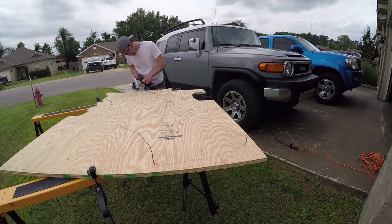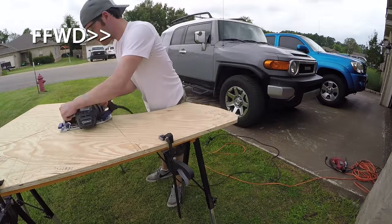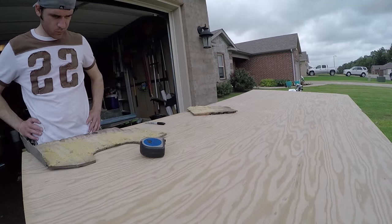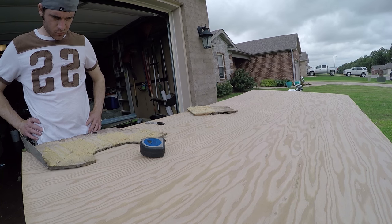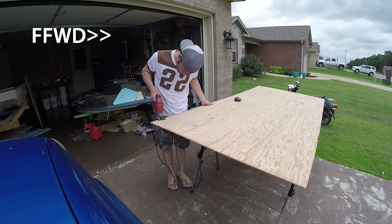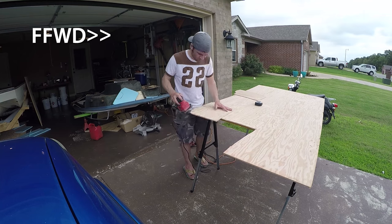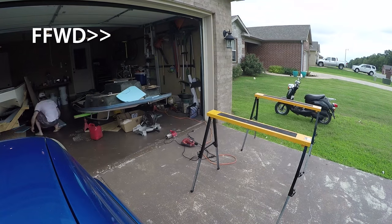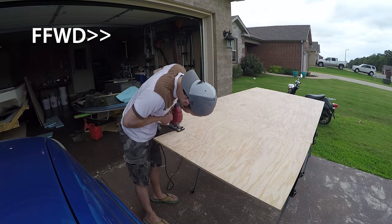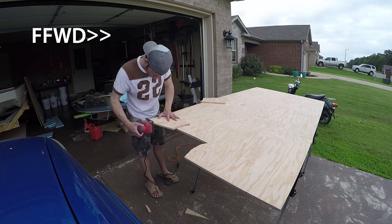So that was another reason I'm doing the blue foam. After I got these cut out using a circular saw and a jigsaw, I moved on to the flotation boxes in the back and just kept cutting all my materials. In the back, I also kept the old flotation boxes just like I kept the old cap supports. I basically broke them in half — each one was made out of two pieces of wood, a front piece and a side piece. They go on either side of the transom in the rear of the boat. Again, I cut these out using a circular saw and a jigsaw. These didn't have much in the way of straight edges, so it was a lot of jigsaw work.